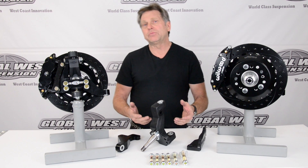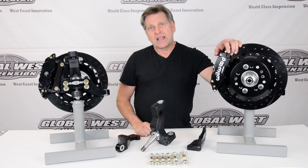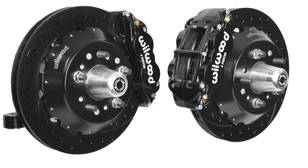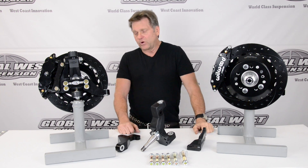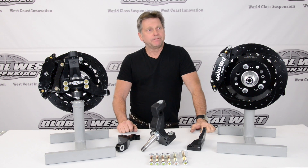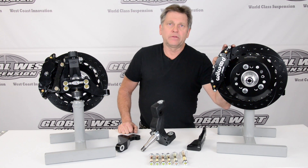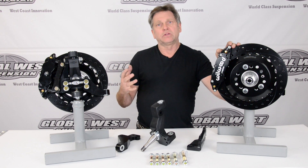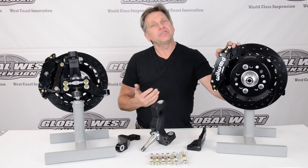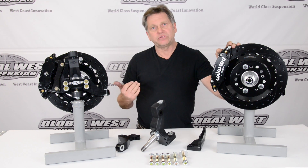We also want to put big brakes on this, and this system allows us to do that. This Wilwood package you see here is a 13-inch six-piston. We're running the big bearing program on this because we're planning on using it in autocross. This one happens to be a 140-104-92D that Wilwood offers. It is not specifically for an A body — it is actually for an F car. But because we're using the large spindle pin rather than the small, which is what A bodies generally use, this brake package is going to plug right in. And that's why we're using it.